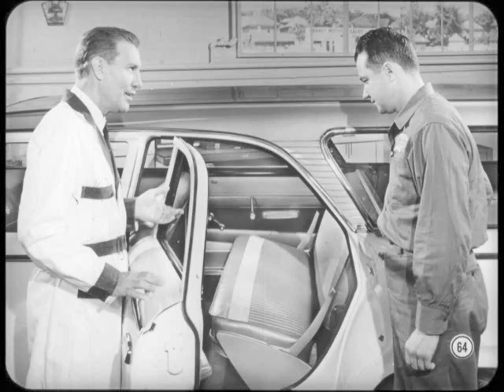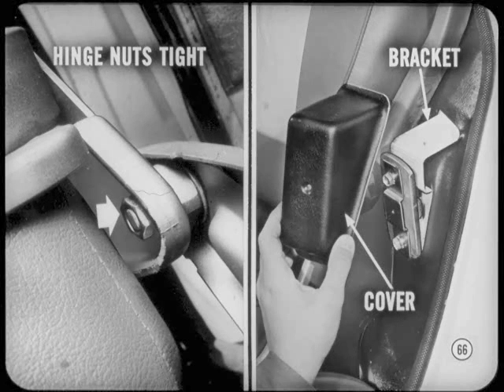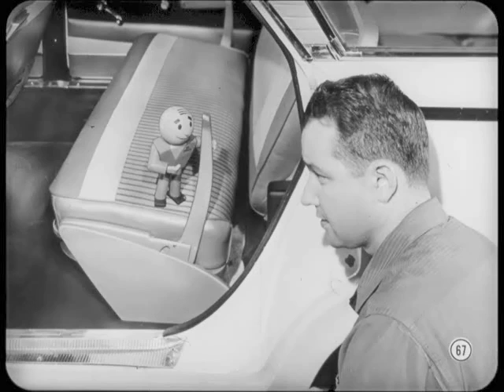Now let's talk about seats. There are occasional cases when a Suburban second seat or seat back may need adjustment. If the seat cushion is out of line, fold the seat forward, pick up the mat, and loosen the three mounting bolts on each side. Move the seat side to side, fore or aft, to equalize or square the seat so the legs will contact the shelf angle properly. Make sure the hinge nuts are tight to prevent noise. The seat back hinge pivots are mounted on inner wheelhouse brackets with a serrated top portion. Remove the molded cover that conceals this bracket, then loosen the bolts to raise or lower the seat back.